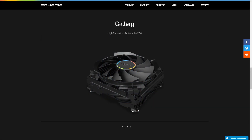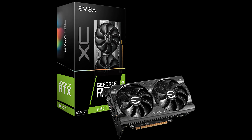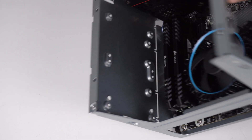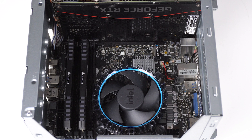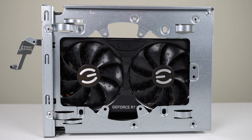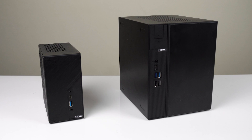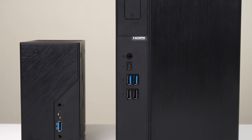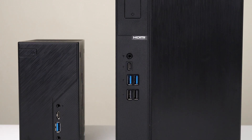I think the ideal non-tinkering build would be an i5-12400 using the Cryorig C7G and the EVGA 3060 Ti. Of course, the power supply can be switched for an SFX to get more cooler clearance and a bigger CPU cooler. I've suggested ASRock makes a DeskMeet variant with a custom SFX power supply. I also think there should be cutouts on the frame where the large storage drives go, with some fan mounts to allow a case fan to be mounted - it would really benefit CPU cooling for those not using larger storage drives. If you only use integrated graphics in the DeskMeet, it's possible to mount a 120mm fan or AIO liquid cooler at the front, but I don't see a great reason you'd buy the DeskMeet over the Desk Mini for an iGPU build when it's so much smaller - unless you really want to use desktop RAM or need the additional USB ports.